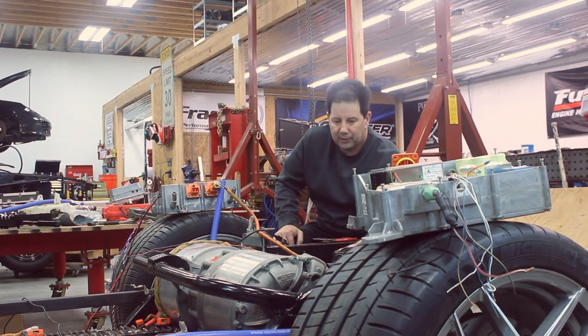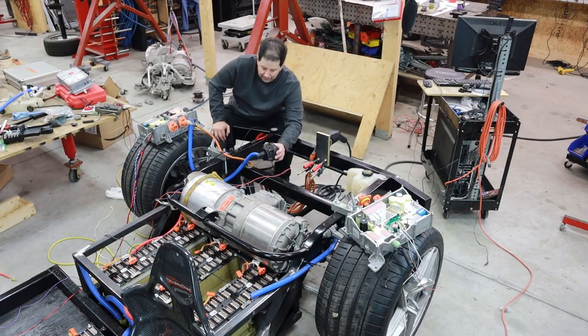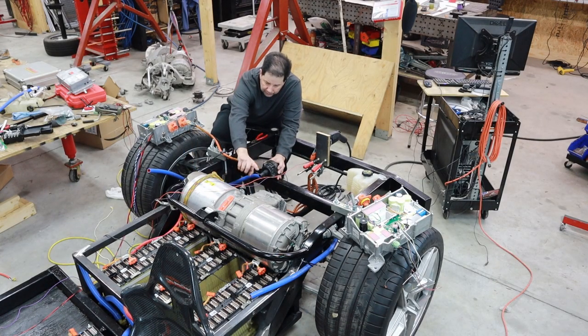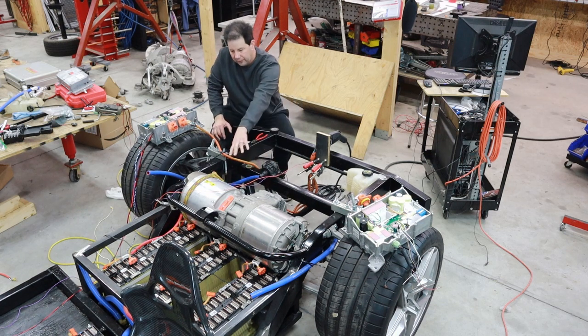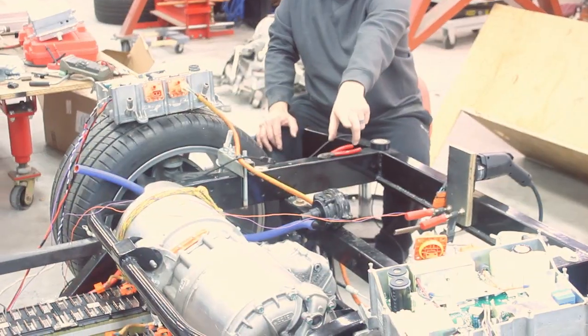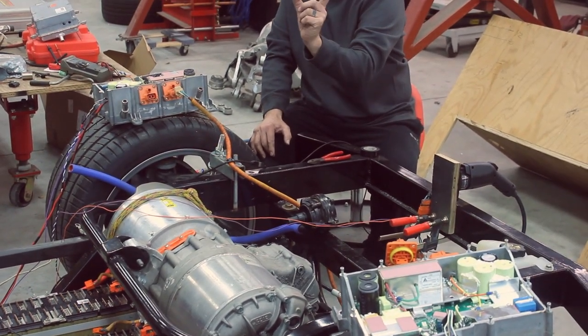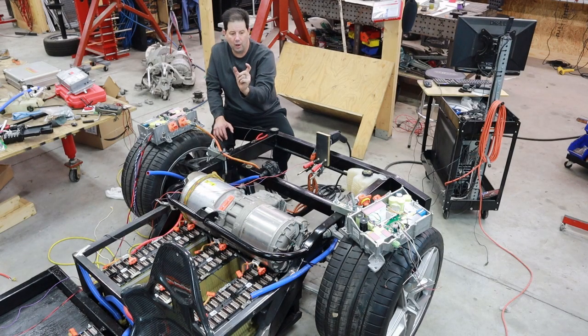So what I'm doing there is I've got, again, this nice Chevy Volt product, this Volt pump, and that's going to go right here. I've got an elbow on order that's going to go into the actual Tesla motor itself. That'll pump coolant to that side. I've actually got to make a custom piece there. The normal Tesla one is long and it comes straight out.